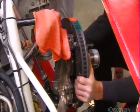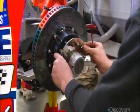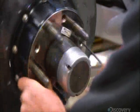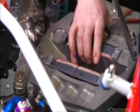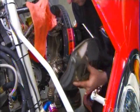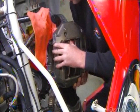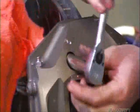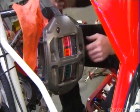Next, they install a brake rotor, then a steel spacing plate between the rotor and the wheel. This sets up the specific distance from wheel to wheel that NASCAR rules require. They load a pair of brake pads into a brake caliper and slide the caliper onto the rotor. The caliper contains different sized pistons so that it applies the brake pads to the rotor evenly.